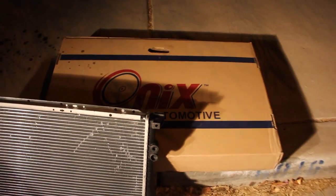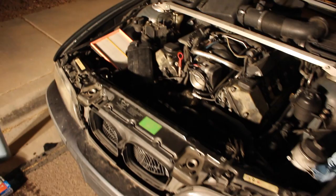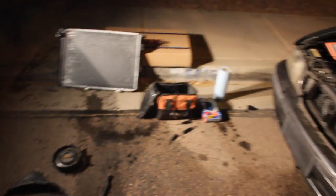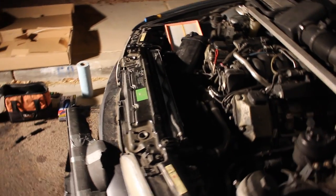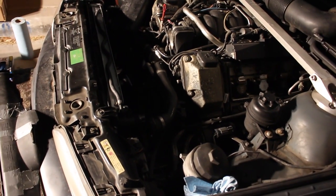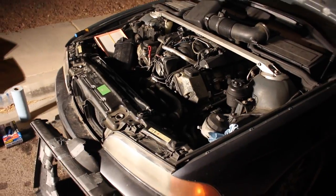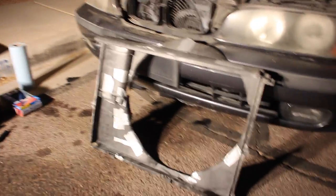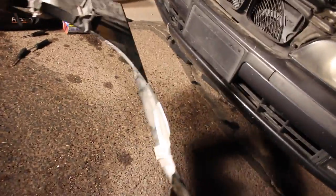It's pretty extreme damage. And right there you see a box with a new radiator — the exact same hundred dollar radiator I put in, just a new one. I'm not going to spend any actual money on this car. So let's get that in there and start putting stuff back together. Shout out to my friend for letting me do this in her neighborhood with the HOA. The new radiator is in — that took even less time than taking the old one out. The upper radiator hose is loose so I can fill it from there, which is a nice trick to fill up a new radiator and minimize air bubbles. Down here is the newly repaired fan shroud featuring the finest in duct tape craftsmanship.